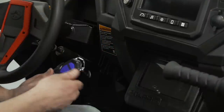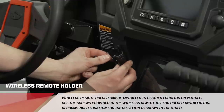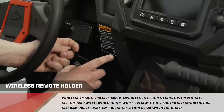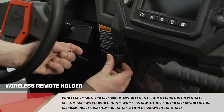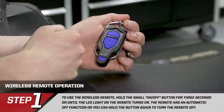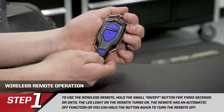The next step is mounting the wireless remote control. The remote sits in a holster — the recommended location is on the dash. Drill a 1/8 inch pilot hole and run the provided Torx screws into the dash, controlling drill depth and ensuring nothing is behind the dash. To power on the wireless remote, hold down the power button at the bottom — the red light will illuminate. Operate with the in and out function. To turn it off manually, hold down the power button until the red light goes off.